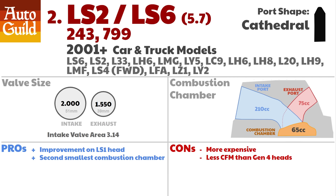The second family of LS heads are the LS2 and LS6 family. Launched in 2001, these heads have two codes: 243 and 799. They are an improved version of the LS1 cylinder head. Originally designed for the LS6, GM started putting them on practically everything in 2007, including even on 4.8 engines and the front-wheel drive LS4 engine. CFM increased from 240 in the LS1 heads to 260 in these new heads. The improvement is mostly seen at higher RPM and higher lift, and professionally ported versions of these heads can flow up to 350 CFM. The 799 code is exactly the same as the 243 code — this is likely the best Gen 3 head.